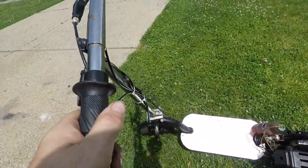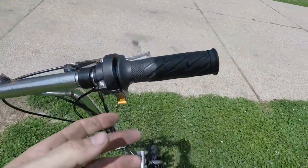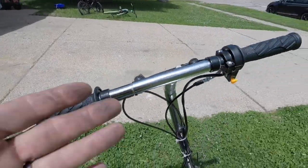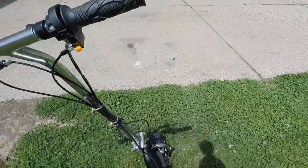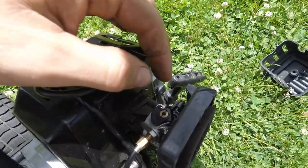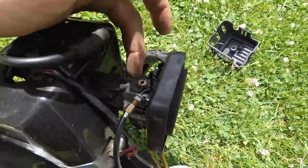The handlebars are completely stiff and kind of janky. It looks like the grips aren't original - they've got tape underneath there. They're probably the wrong size, but it's got new grips. The throttle cable feels crunchy so we'll have to deal with that. The carburetor's right underneath here, and there's a zip tie holding the throttle cable on. The carb's got to come off - we need to look at it and clean it.